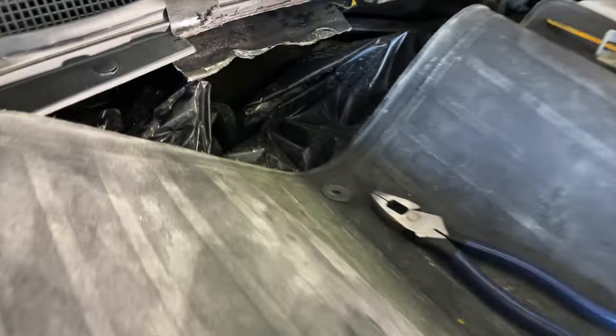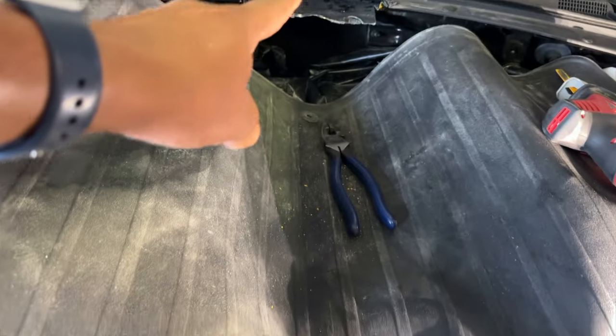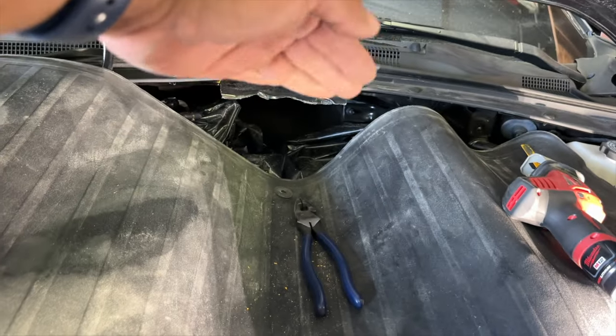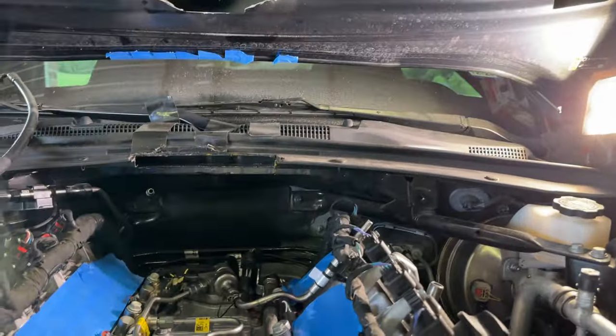For the sound tube, I'm deleting it — there's just one nut right there and it pulls all the way out. To run the high ram you need a new hood or you can cut the one you have.